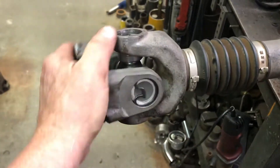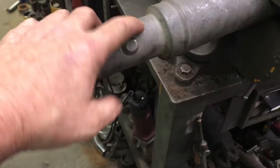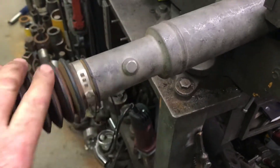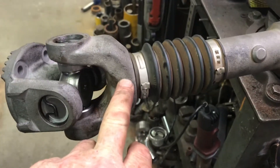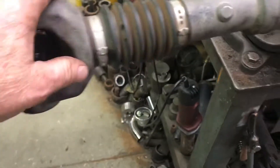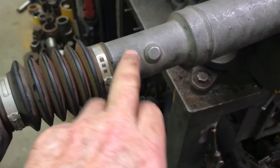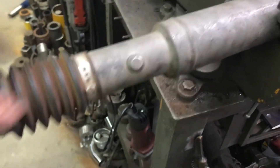They had good lifespan so she's getting Neapco joints again. I didn't put a grease fitting in — this is actually a splined stub yoke shaft, it's not a slip yoke. The female parts are here at this end.